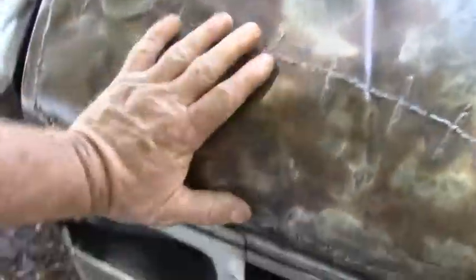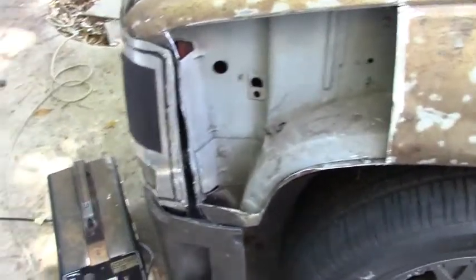When I fixed this accident damage, I had this whole fender cut up, re-welded back together. Same thing here, this was all smashed in. Rebuilt the grill, all this plastic was smashed. This is all just real thin aluminum, pop riveted together. Made my own lens out of some clear plastic. You know, same thing over here. So it's getting there. Show you how to do some stitches.